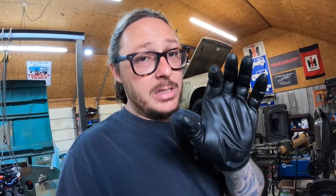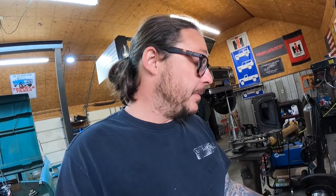You've got two seals on this to keep everything back — you've got an inner axle seal and your outer axle seal. We're removing that inner axle seal and depending on this outer seal to make a good solid seal to keep fluid from leaking. Because nobody likes leaky axle shaft seals — what ends up happening is you ruin your brakes. So be super careful when you're cutting this clench ring and the bearing off. Because if you nick that seal surface, you're beat — you need a new axle shaft.